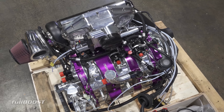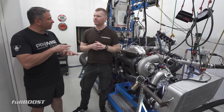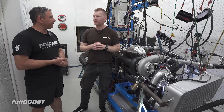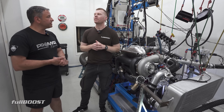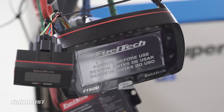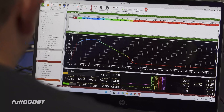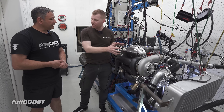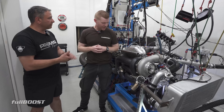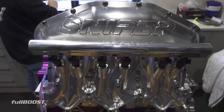I can't get over how quiet it is — it's a beautiful 20B package. Do these run the similar FC-style rotors? Yes, and on this one we put FC rotors, lower compression. We compromise in spots and try to make the package safe and reliable everywhere. If we had a bigger turbo we would have run higher comp rotors. This is also running a complete FuelTech package: FT600, FT Spark, the injector peak and hold pro box, ignition coils — the whole lot. We chose this setup. Even distribution for your runners. Billet anything looks good, and it's a nice manifold that seems to be working quite well.